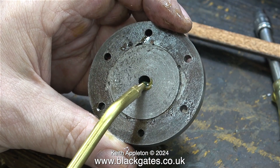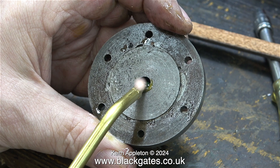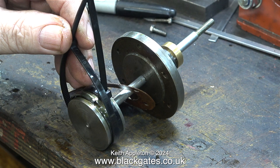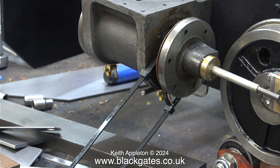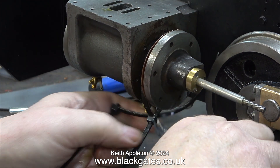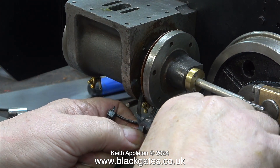Here I'm applying some oil into the hole where the piston rod goes. And that's more or less it — I now have a very oily mess on the end of the piston rod, but at least it's fitted with piston rings. In this clip I'm fitting some cable ties to compress the rings. Yes, I do know what a piston ring compressor is, but I don't have one — I've got plenty of cable ties which work just as well.